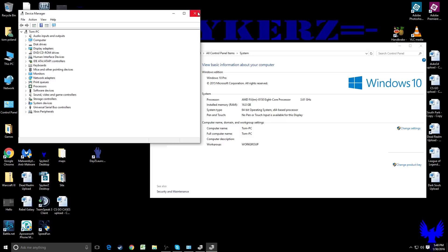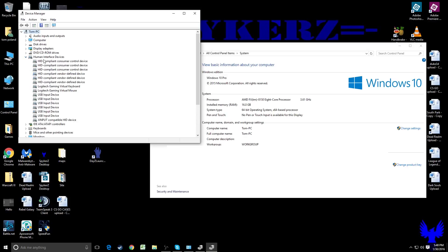It'll pop this up as well, or you can right-click on the computer icon, go to Properties, select Device Manager, and there it is. We're going to look under Human Interface Devices here, and it'll show up at the very bottom as an XInput compatible HID device. What that means is it's an Xbox controller and it's a human interface device. So let's go ahead and close that out.